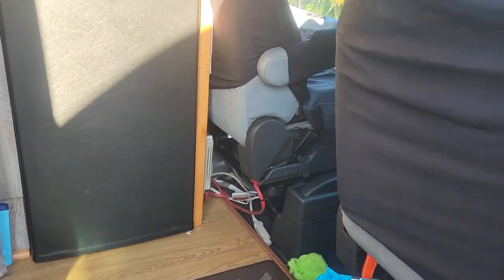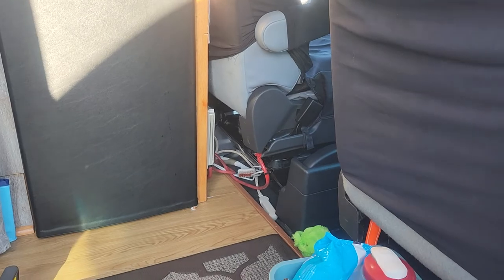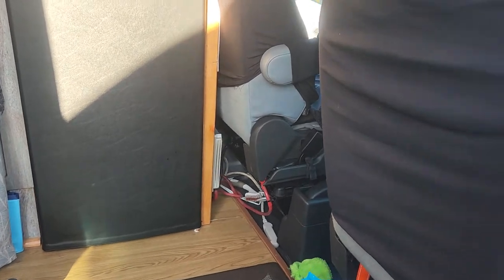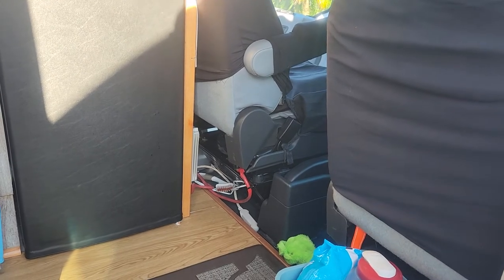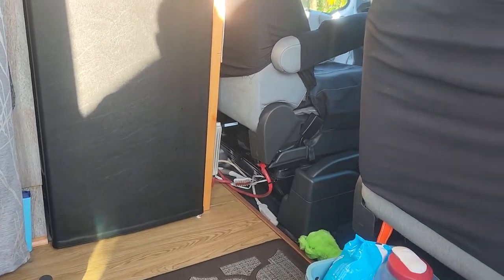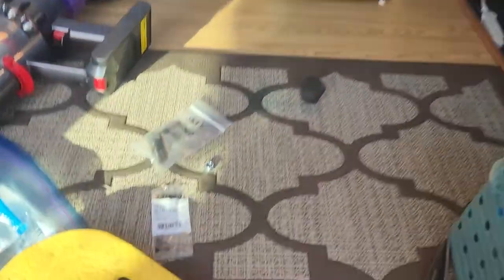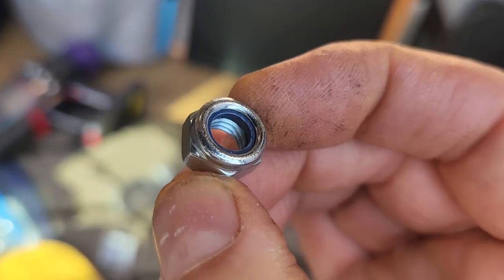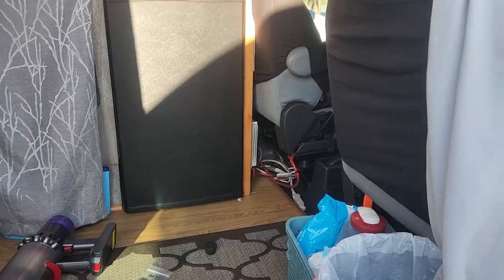So that's pretty much how to get your driver's seat to come back and up. Going up is optional — you can raise it with bushings, or you don't have to use the bushings at all. You can use nylocks or lock washers with a standard nut, but I think nylock is better unless the nylock is worn out. If a nylock has been previously used you can tell by looking at it — if it doesn't have grooves in it, it's good. And that's how it's done.